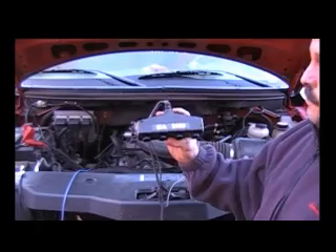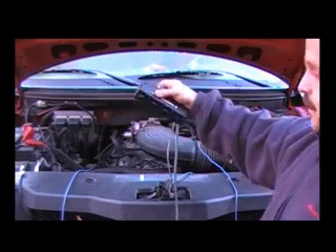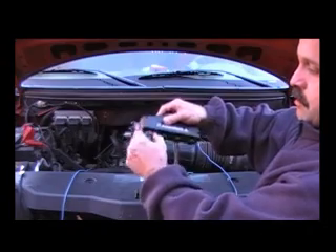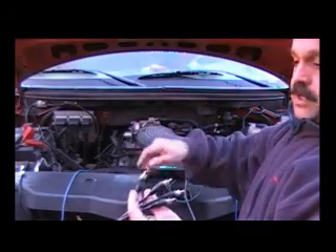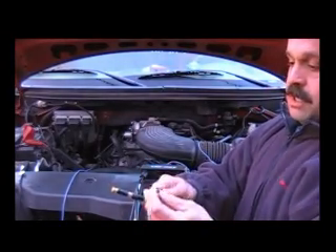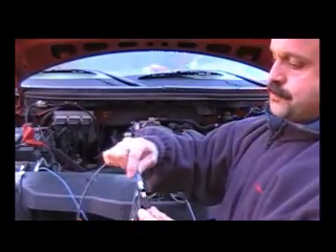We're going to take the SIA-2000 and look at the boom side. There's a negative and a positive side — make sure you use the negative side of the boom for your coil-on-plug vehicles. There are alignment tabs on the plugs to line up with when you plug them in. Get them lined up just right and tighten the connector all the way until it latches. Then take two of the ends on the RCA adapters — you'll need to use these little barrel adapters. You can get extra ones from Radio Shack if needed. Then adapt them to the blue leads of the coil sticks.